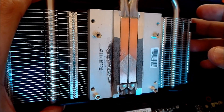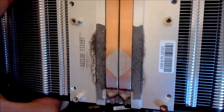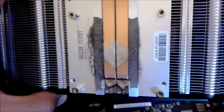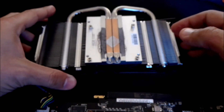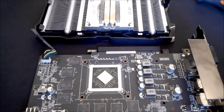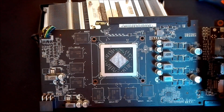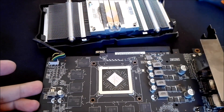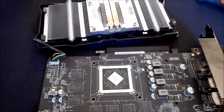We're going to try our best to address the corrosion of the aluminum. This is what happens when you apply Liquid Ultra or Liquid Pro on aluminum — it just destroys it. You can see that for yourself. But the copper on the other hand is intact, which is expected. Liquid Ultra doesn't react negatively with copper. We're going to clean the die and hopefully there's no damage there from corrosion, and hopefully the card is still working.